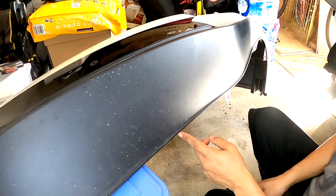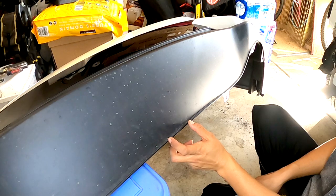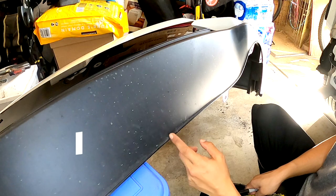I can see where my center mark is right there, and the part of the hitch that protrudes outward is about two and a half inches wide. I'm going to center it within that line and go maybe about another two and a half to three inches vertically out.